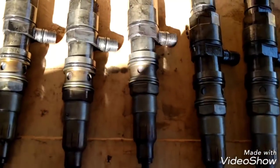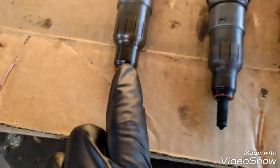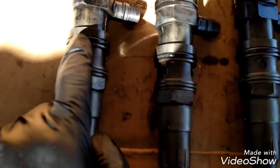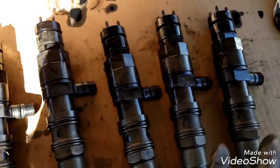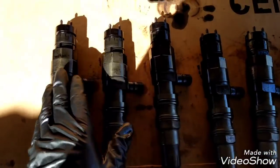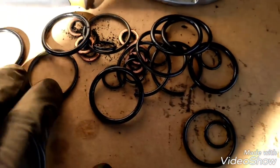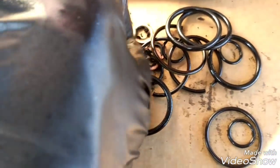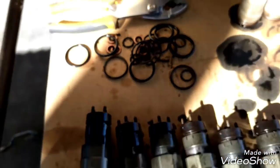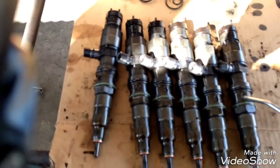After placing all the injector cups, the next thing to do is to replace all the injector o-rings and the crush washers — one, two, three o-rings per injector. Remember to install the injectors in the same position as you removed them. All injectors now have new o-rings and new crush washers. The old o-rings here are all dried out and deteriorated.